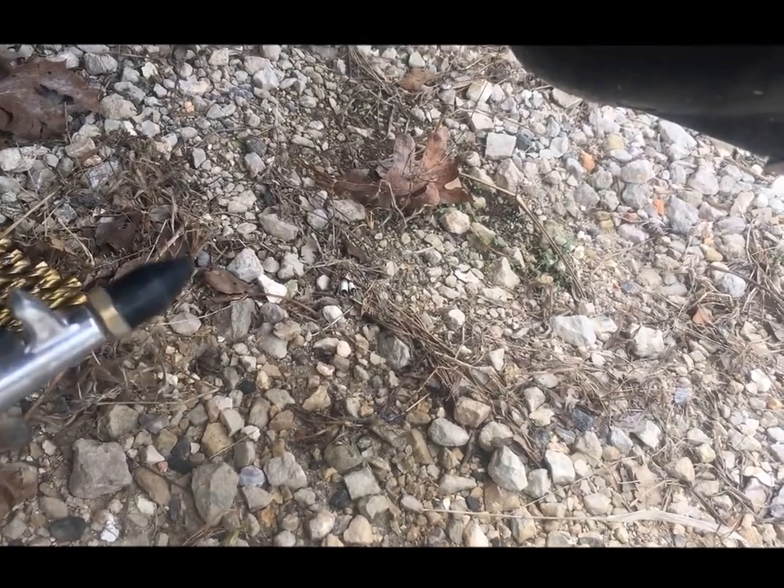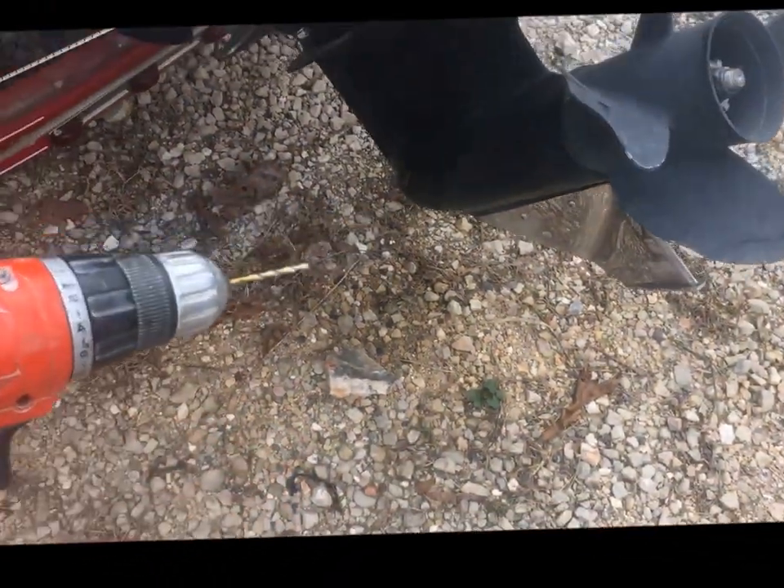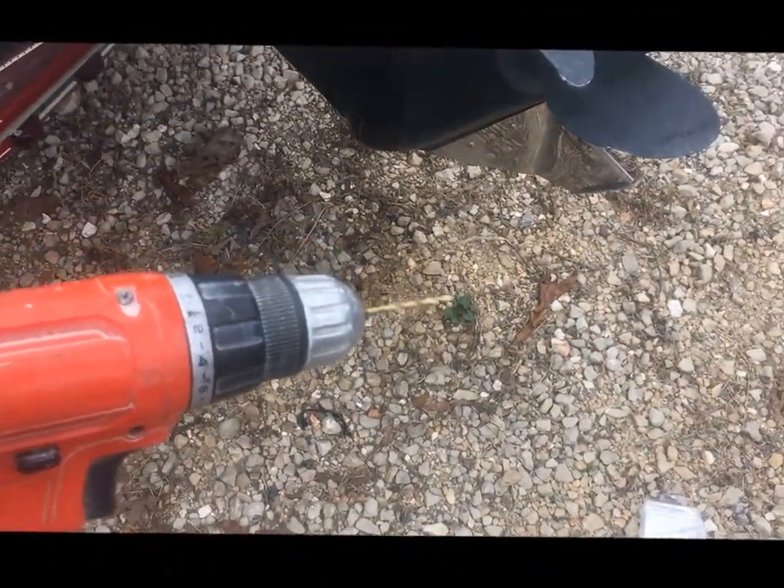This is a little air tool. Typically if I'm away from the shop, I'd hook this up to air — it'll blow air through here. So you're going to shoot compressed air through there. If you have a friend looking at the speedometer for you, they can tell you if the speedometer is moving. That's all you've got to do: clean out this little notch — try by hand first, use a screwdriver, then use the compressed air. Hope that helped you.